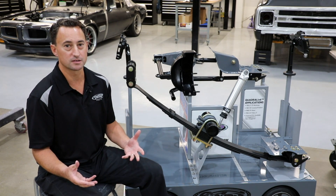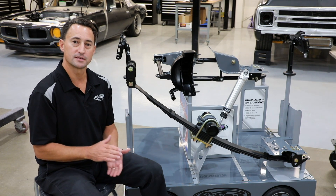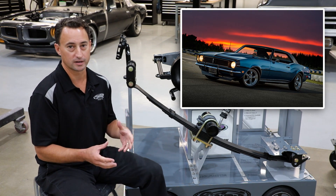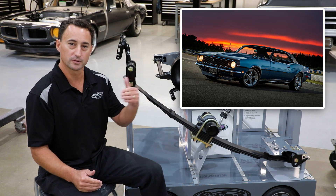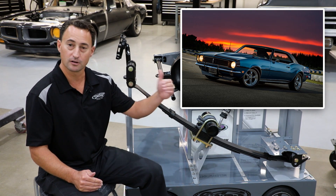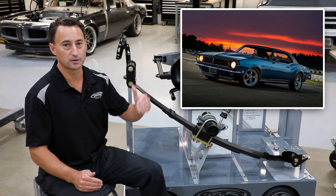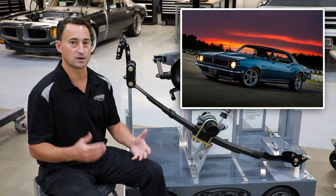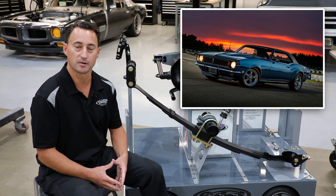One of the biggest questions is, which one do I use for my vehicle? For the 67-69 Camaro Firebird, we recommend either a 2-inch or a 3-inch. It really depends on what you're doing with the front of the car. Say you're dropping the front 2 inches — you probably want to do a 3-inch in the back to give you a level stance. If you're looking for more of a rake, we'd recommend the 2-inch drop leaf spring for your first-generation Camaro Firebird.